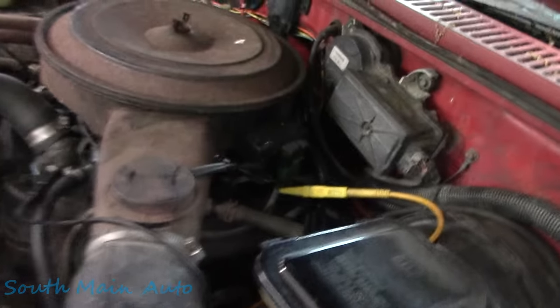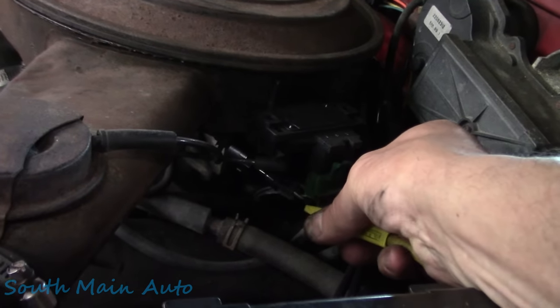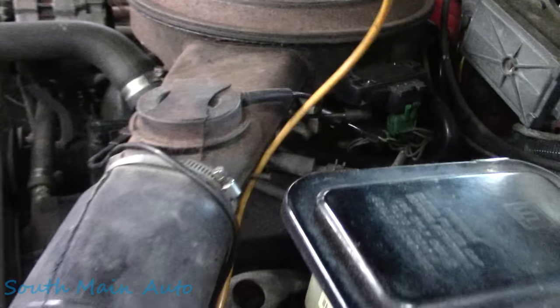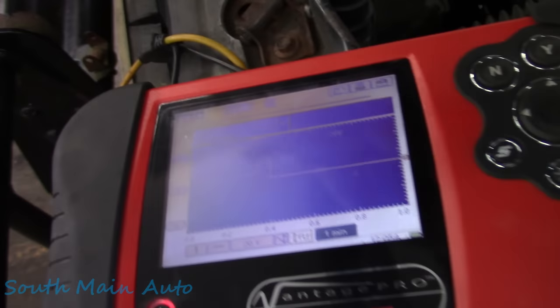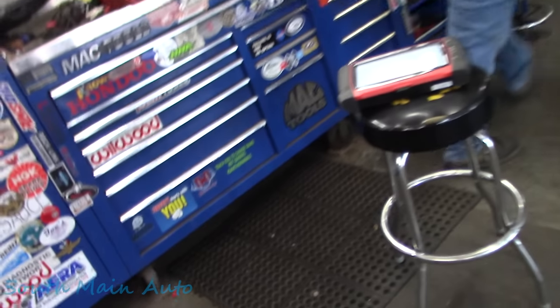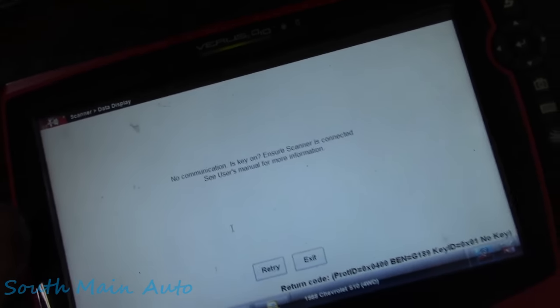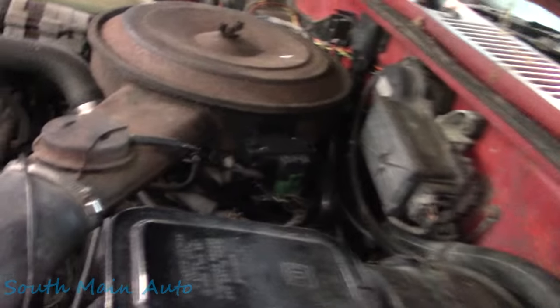So I quickly just back probed into the signal wire. I went down through this, checked, did I have 5 volts, did I have a ground, what's my signal, left it in the signal wire, and you could see it was reading pretty steady at 1.45 volts. But when we looked over here on scan data, oftentimes it was just at 0. And the TPS was at 0 also. I wasn't able to probe that quickly.